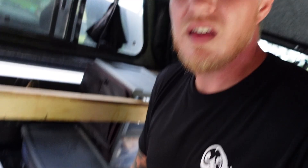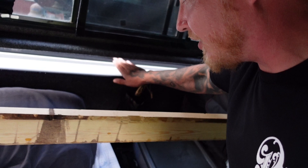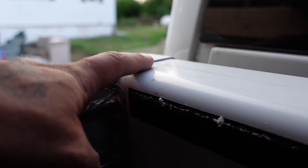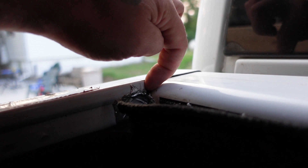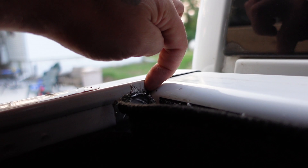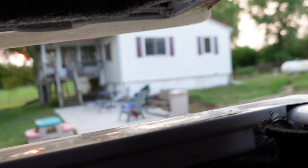All right, so I'm inside the truck and I'm wiping off this front bed rail. Over here in the corner, right by the head of the bed, kind of below the carpet, you can see I've got this foil tape on there — that was to seal this gap, and I did that after the topper was on. I didn't realize there was this big hole here. So we are going to fill that with RTV on both sides. There's like a big hole there, so if water were coming in, it could easily run along this, come in right there because the seal might not be perfect, and run down. Right here is where the bolt is that it was probably dripping off of.